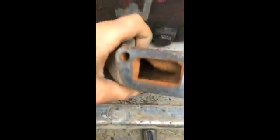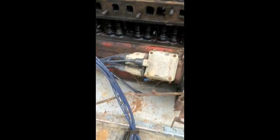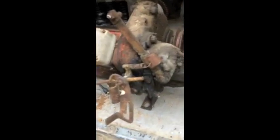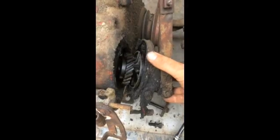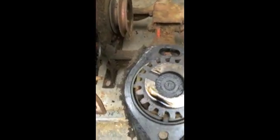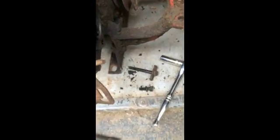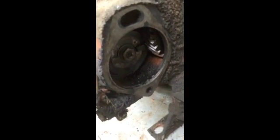You can see where it's actually visible through — you can see where you'd have all of the coolant passing right over it there. Next, we're going to be removing the magneto and the governor. We'll pull the two bolts on the governor's side and then pull the single bolt on the magneto side. Pulling the governor out, you can see it still actually has gear oil on it, which is a good sign. And you can see that would be the internal side of the magneto.